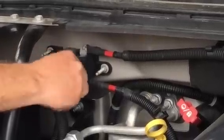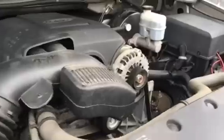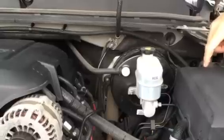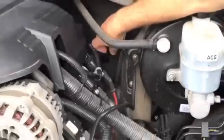If you notice right here, the negative lead goes right to the battery. I took this off and took the wire brush to all of it. I still don't think that was my problem though. I think the problem was this grounding strap right over here. There's a grounding strap in the '07 and later GMCs that goes from the body down to the engine. The negative goes through the engine and then into the body to provide ground to the rest of the body. This strap, after I really started looking at it, was getting bad down there. But because it was so hard to get to behind the engine — there's just no room, maybe use a crow's foot or something — I couldn't get to it easily.